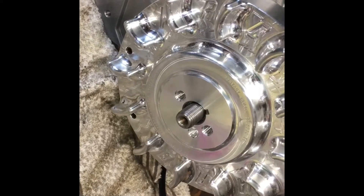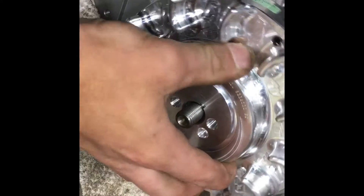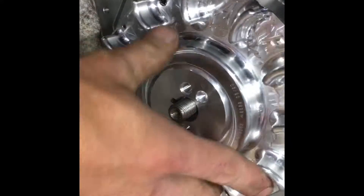Now as you can see, the crankshaft has its own taper, and then inside the flywheel here it is also tapered. So what we're going to do is get our lapping compound, put the flywheel on up on the taper, and you just rotate it. There's nothing particularly technical about these processes — it's just stuff that people don't usually take the time to do. All those little things add up to one great thing.